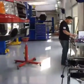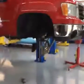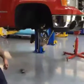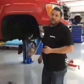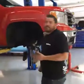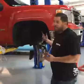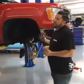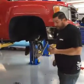Anthony, no questions? Nothing. We did have a question: will it affect the towing at all? Will putting a lowering kit affect your towing at all? The only thing it would affect, geometry-wise, it doesn't affect anything. The only thing it would affect is if you're bottoming out after the fact. And what you would do there is either add a C-notch, which isn't required on these, but if you're slammed and you're towing every day, that's a possibility.